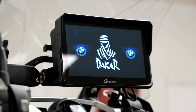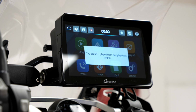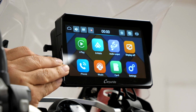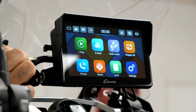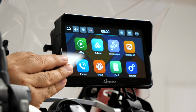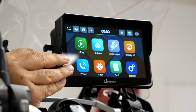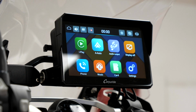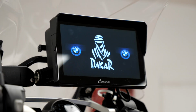It's nothing complicated. Now it's worth remembering that now that it's loaded, we want to get the micro SD back out, because you don't want it to keep trying to change every time you power it up. And that's where the tweezers are handy. Now I can just pull the micro SD out. And we're done. That's the Bootscreen loaded, as you've seen.